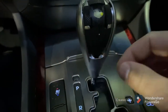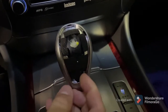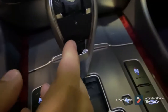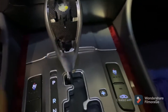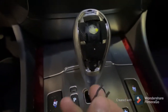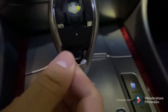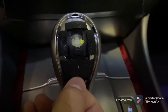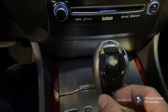So behind this black piece of tape, there's going to be a little slot right here — I know it's kind of bad lighting. Inside that slot is this retaining pin. This will be in that slot like this, but all the way in. So you're going to need to get like a needle nose or a Phillips head, something like a screwdriver — you're going to kind of pry in there and pull this piece out. Once that piece comes out, just put it right there. Then you'll be able to pull straight up on it and it'll come off — a little bit of force, but it comes off.